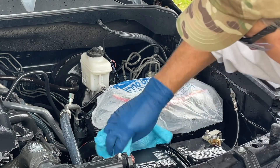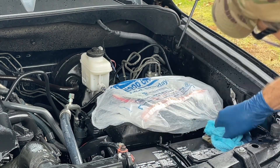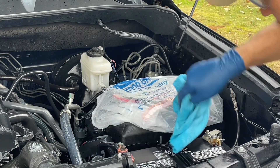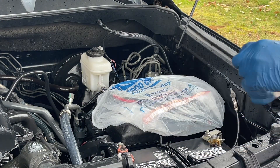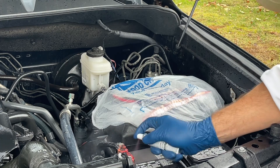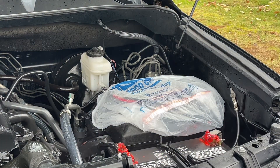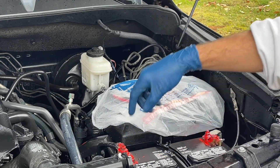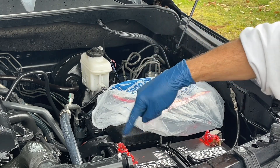Again, let's wipe everything down clean and dry as we can get it, and then we'll put the battery terminal protective spray on it. So maybe that'll actually slow things down. We got the protective spray on it. We'll let that sit there and dry a little bit. I will have to take that back off so I'll probably get some of that all over me. That's kind of how you clean a battery terminal. If I could have got this off, you'd want to take it off, take the brush into that, take it down on the terminal, take the other brush in, take it through the cable, put it back on, put the washers on, put this back on, tighten it down, then spray this protectant on it.